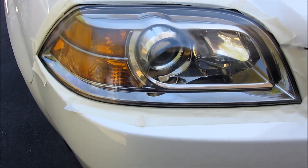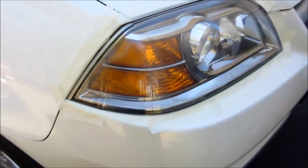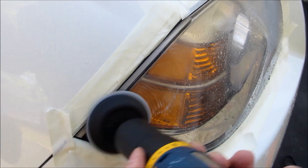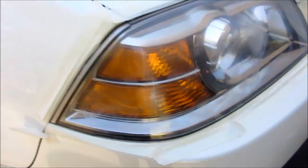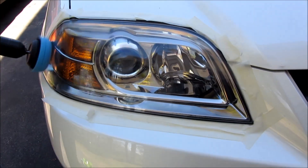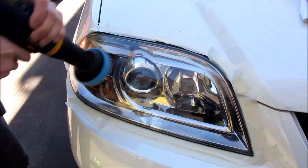That's the frosting and discoloration on the passenger side — it actually looks worse in person. I'll zoom in here, spray it down, and get started with the sanding again for this side. Right away you'll see that slurry appear. I'm going to breeze through the left-hand side quickly — and now I'm buffing it. You can see it's already looking a lot better.